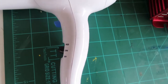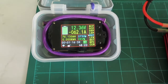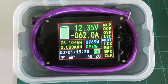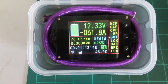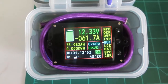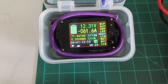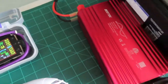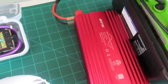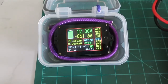We're on low fan and low heat — let's try high heat on low fan. Booyah — 762 watts! That's about 50% over the 500-watt rating. Again, I ran this load for about five minutes and it held. I'm not saying it'll do this all day, but it is encouraging that it does it at all.